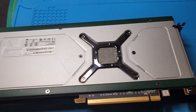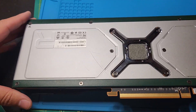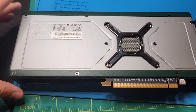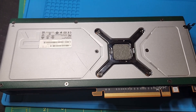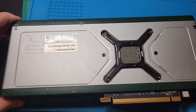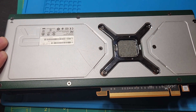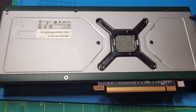Obviously there's something wrong with the fans. I'm going to pull off the fan shroud and take a look at the pins. I saw a video on Gamers Nexus about how they disassembled it, so it doesn't look too hard. I want to see if I can either rig up a shroud — I have some Noctua fans left over from a GPU I bought to repair that didn't work out — or I can just go fanless and put fans right under the case.